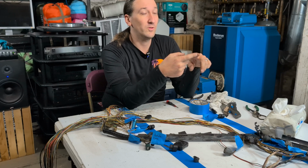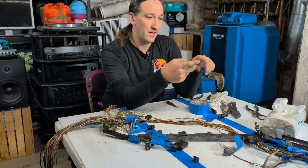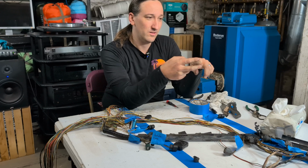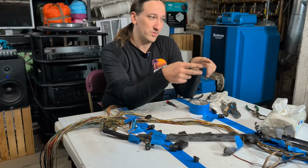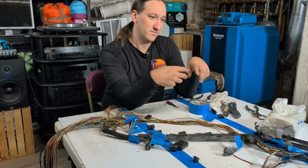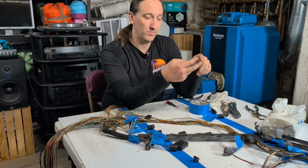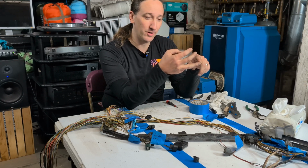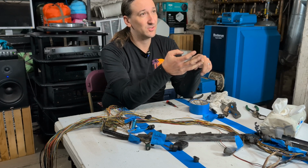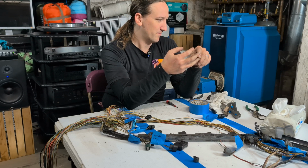usually there's a 12 volt excite for powering the field windings. And then you've got a load, and also sometimes you excite the field winding, but then it needs a load. You send that load back to your bulb in the dash, and that acts as a load, which also gives you a low voltage light by default. And then there's usually also on an externally regulated or externally controllable alternator, a pulse width modulated input to tell it how much you want.